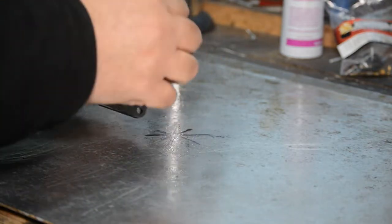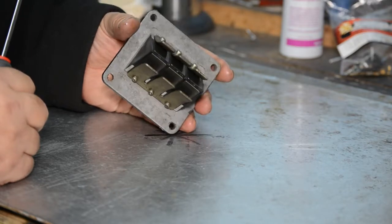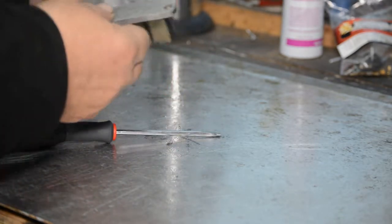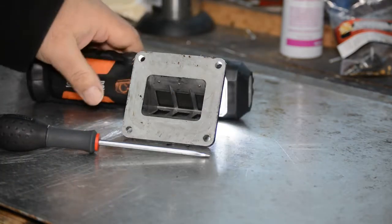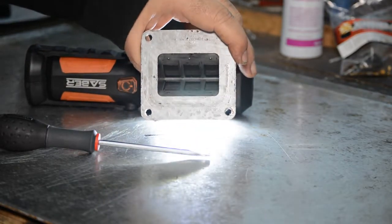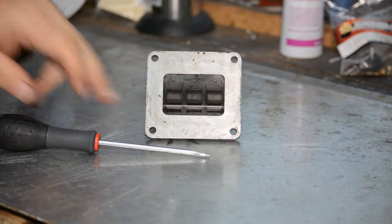In terms of wear, I've checked and there's no chipping or marks on these. In fact they look like new reeds. I can't tell whether they're stock or aftermarket or a performance one, but there's no damage on the reeds and they're seating extremely well. If we look down in there and put a light behind it, we can see it's light tight in there - that's exactly what we're looking for. So there's good surface-to-surface contact. I'm happy with that, there's nothing more to do. It can go back on the bike.